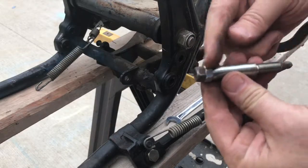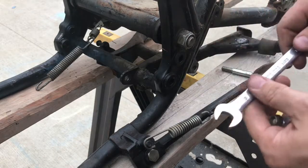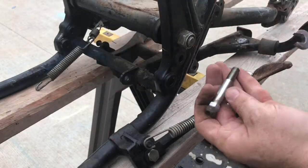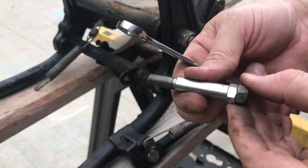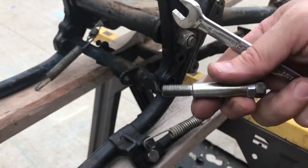It's in good shape — I just have to take these nuts off. The size is 13 millimeter for these and 14 millimeter on the back side. When I put it back in, I'm going to put some anti-seize on it. So there's an extracted stud for a KZ 650 and 750. Thanks for watching.